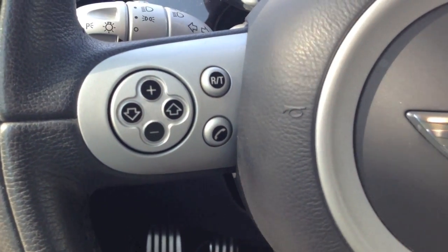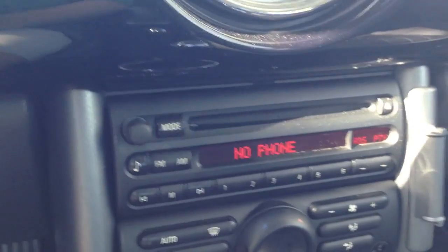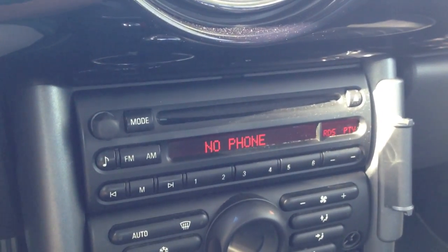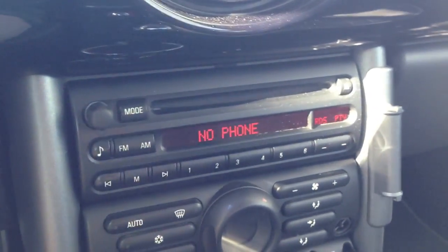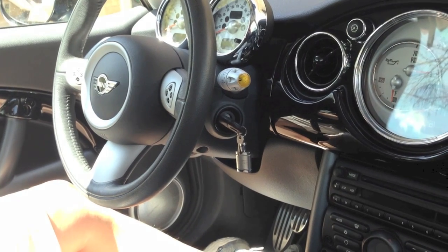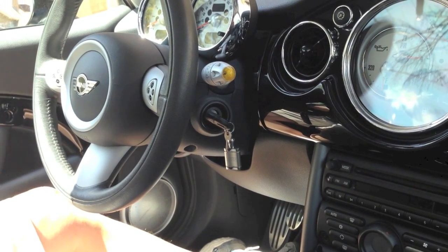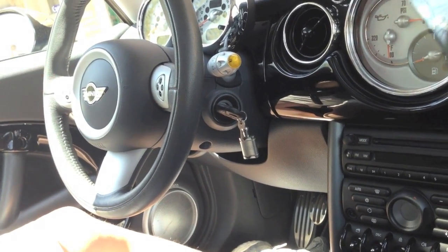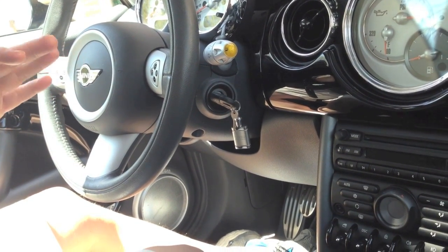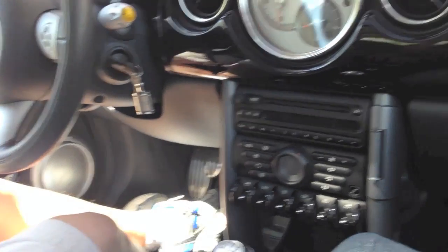When the phone is not paired or if you don't have phone service, you press the RT button and it'll say 'no phone.' As soon as you pair your phone or activate a paired phone, that's going to change. For the BT pairing procedure — you've got the pairing button on the cradle, and obviously the ignition. You just need to move it to position one, and it has to happen in a certain sequence. You'll know when you've done it right when you see 'BT pairing' or 'Bluetooth pairing' on your radio.